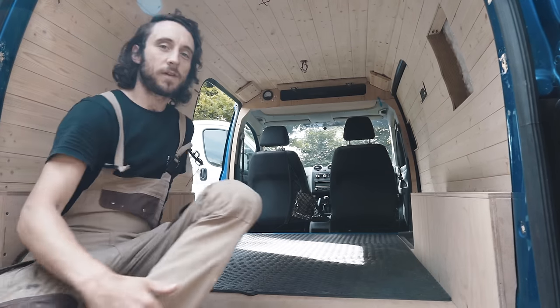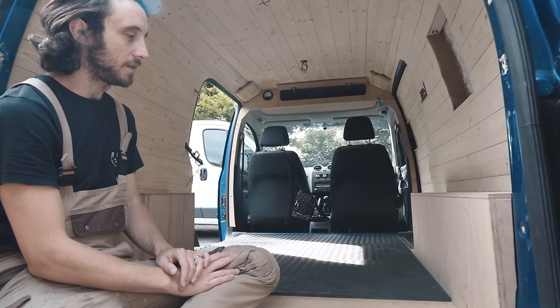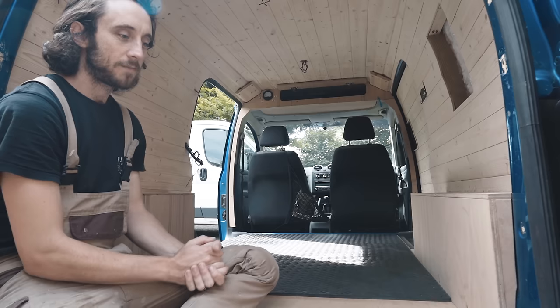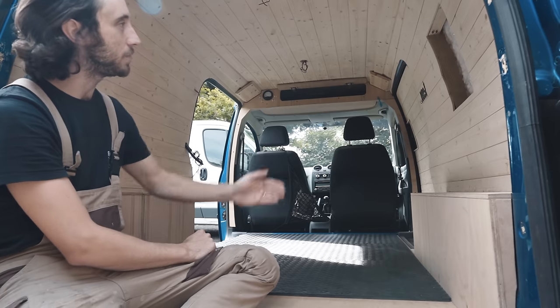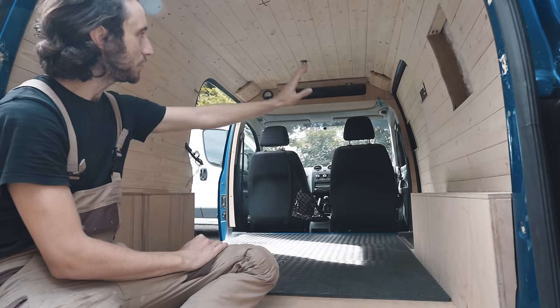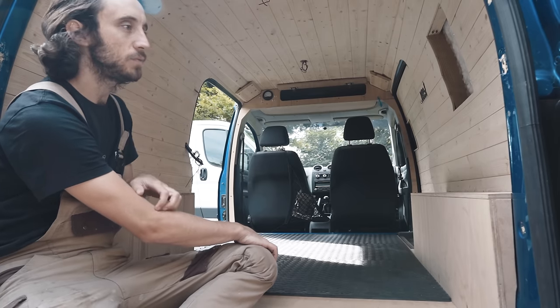Alright, so just thought I'd give you a quick update on how things are doing in here. Because we've basically done the entire sort of structural bones of the van, as it were. We've got the sound deadening, the insulation is in, all the battens were then in place to support the shelving unit and this recessed storage, as well as some of the cladding. Cladding has all been scribed to fit, and all of the screw holes have then been covered with wooden dowels